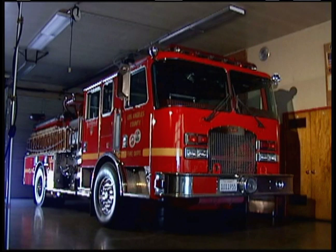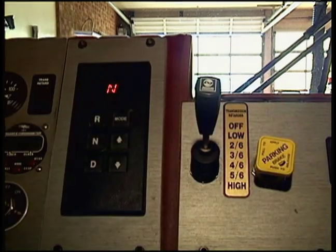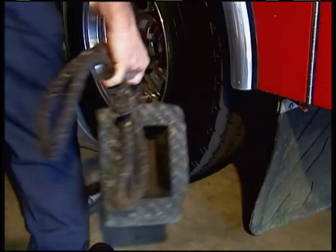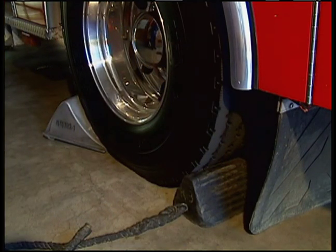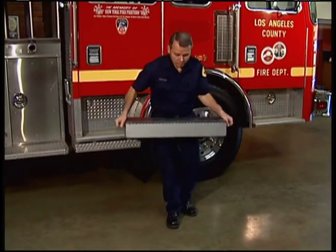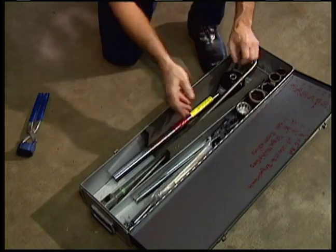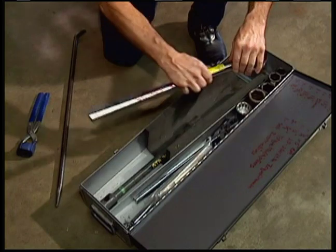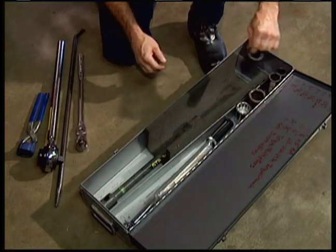Once you realize you have a flat or low tire, pull safely to the right of the roadway out of traffic. If possible, pull off the road completely and find a flat level ground. Shift the manual transmission into reverse, or if you have an automatic transmission, put it into neutral. Set the parking brake and turn off the ignition. On completely level ground, or if you are unsure of the direction of ground incline, place a chock block on each side of the wheel. The chock block should be placed under the wheel on the opposite side of the vehicle on an axle that does not have the damaged tire. To remove and install a heavy truck tire, you will need the following tools: nut cover pliers, tire iron or extension bar, torque multiplier, half-inch drive ratchet, and the appropriate size socket.